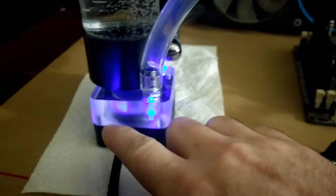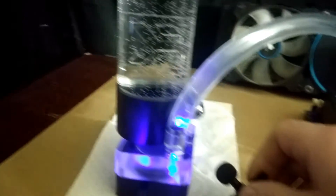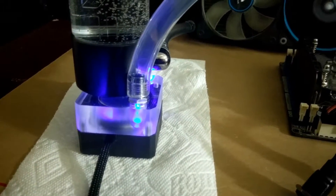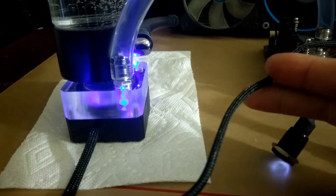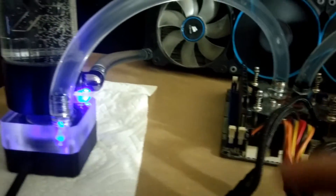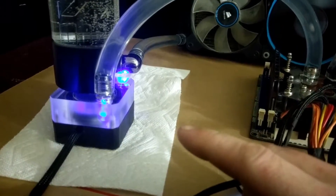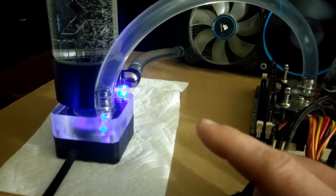See that it works? There's the blue LEDs — this one's reflecting off of the fitting. As you can probably hear, that is running full tilt at about 5,200 RPMs, and it is quite loud. Now since we did change it over to a PWM pump, we can change the speed. Since it is plugged into the CPU fan header, we can have it change speed according to CPU temperature. I don't have Windows loaded, so we can go into the BIOS and actually change the speed — with the microphone right next to it so you guys can hear the RPM changes.